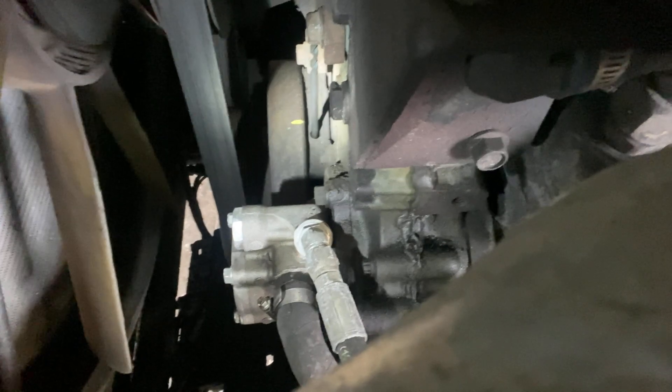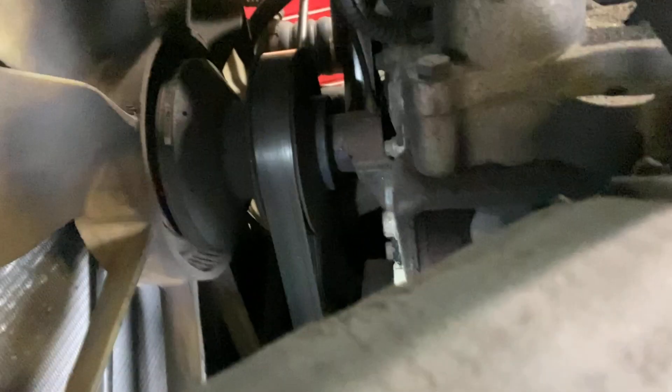You spin that over until it drops. I've already dropped it and you can see I put a little mark line on there. You need to pay attention to this and look up here as you're doing that. If you do like an EGR delete or some of these things, you can advance the timing on it, so it'll be off a tooth. You kind of got to pay attention to that because you won't have your overhead right. But anyways, it's dead on — went ahead and did that, we got it set.